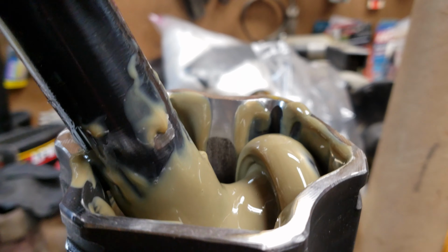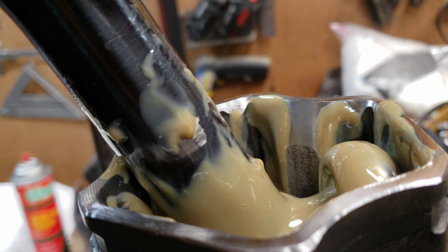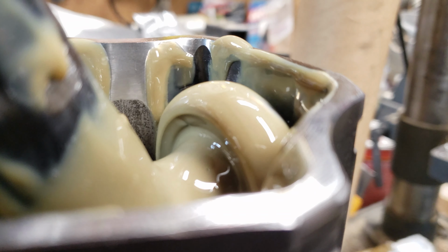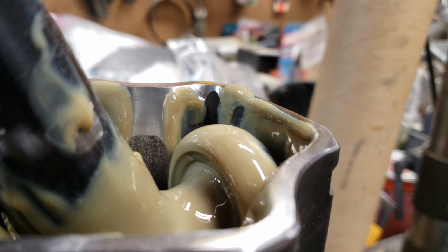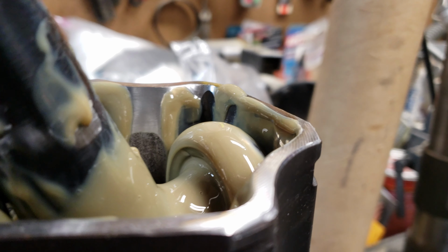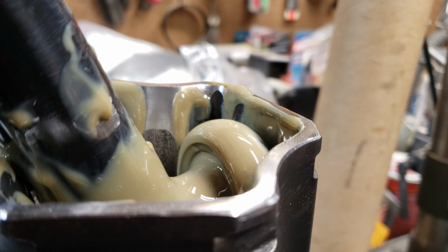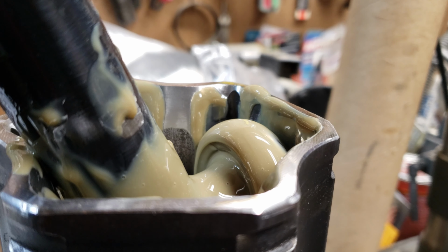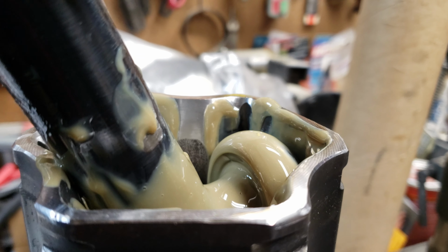So right there is where it was binding. That's the spot on the shaft. You can see that spot worn down on that side of the shaft. And you can see that the tangent point of that wheel is still well below what we were grinding on, which is all it needs for the strength, because the tangent point of that wheel is the only spot that's going to be putting pressure. So that should still maintain all of the strength that it had previously. And that's what I was going off of on how much I wanted to relieve.